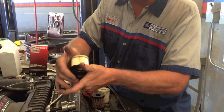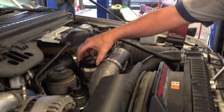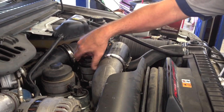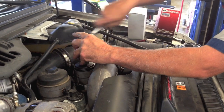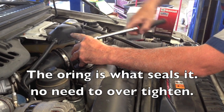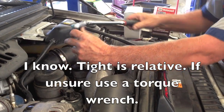With the genuine, I'll stick it in there first, make sure it's flush, and just bring it down slowly so I don't spill a lot of fuel. Then I snug it up — the spec says 14 newton-meters, but in the real world we just snug it up, don't bear down on it, just snug it up, and that works.